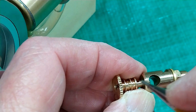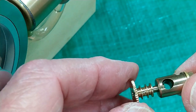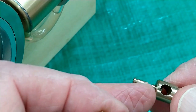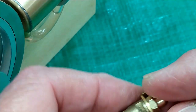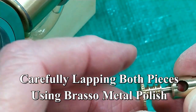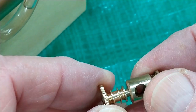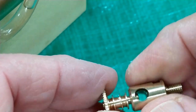At low speed it doesn't need as much fuel, and enough fuel would hopefully come through the slot. This disc should remain stationary — the drag of the O-rings will hold it in place and allow the barrel to go back and forth without moving the disc's position. This piece is not machined, it's just a casting — it's rough — and it kind of snaps into the other piece. I'm going to chuck this up in my lathe and lap these two together with a little Brasso so that disc stays stationary while the barrel moves freely. After spinning them together it still clicks a little, but once assembled it's quite smooth, which will either improve things or it will leak air like a sieve.